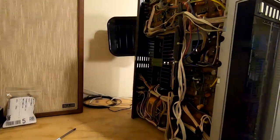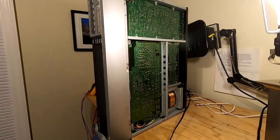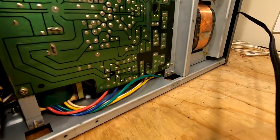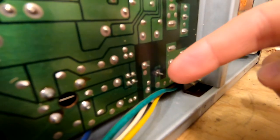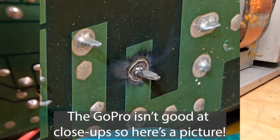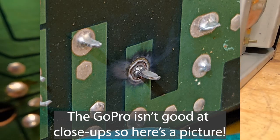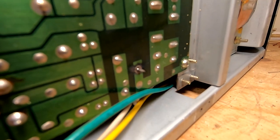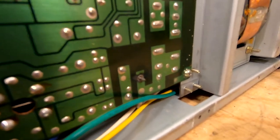Off camera I got this thing apart a little bit further, just took some of the panels off including the bottom panel, and I was checking for power off the transformer. I was looking closely right here and I found this — that is not right, and I'm not sure what caused it yet. I might re-solder that and put it on the dim bulb tester to see what happens. I think I've found where the problem starts here — that right there is basically right off of the wall outlet.